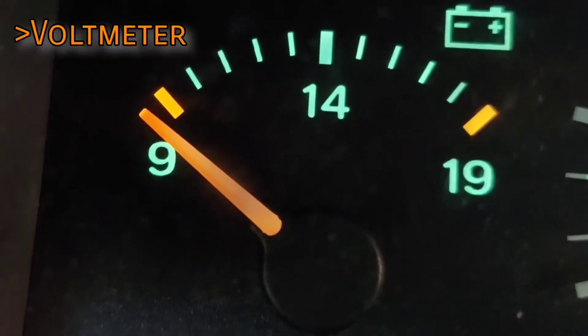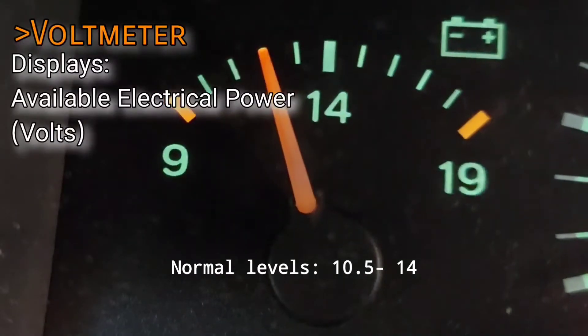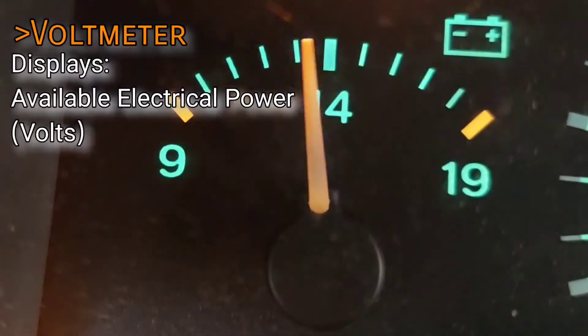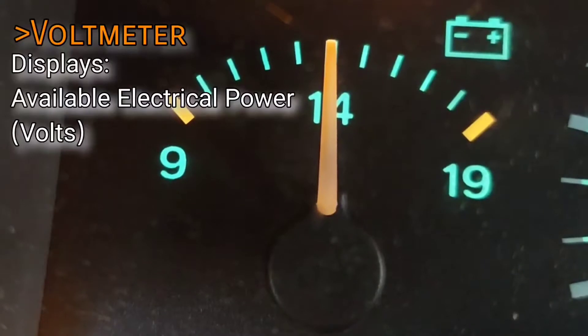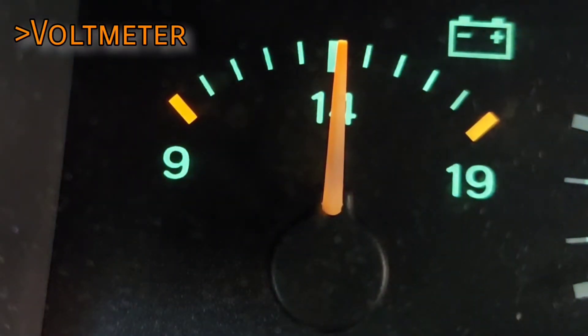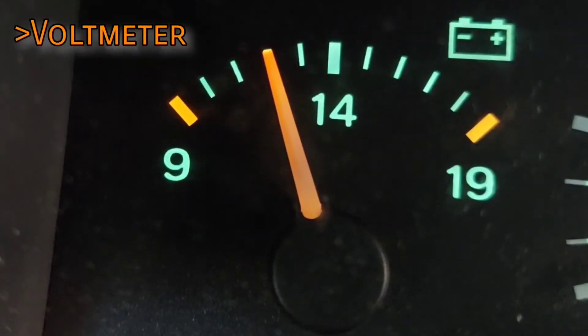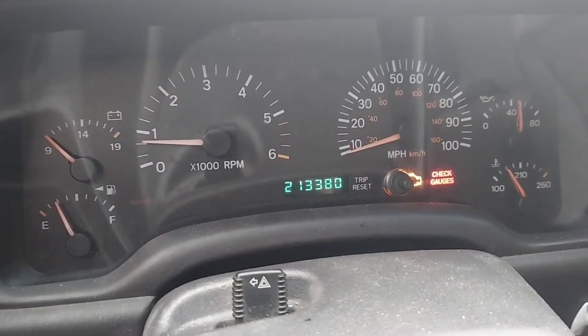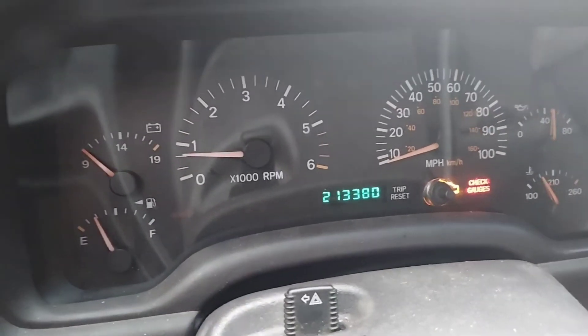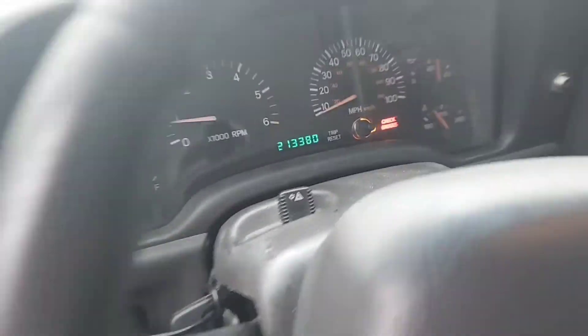The upper left gauge is the voltmeter, which measures current voltage in the electrical system. When the engine is off, it should rest at around 12 volts. It shouldn't fall below 10.5 volts while cranking over, and while running it should be at 13.6 volts. If it reads lower than normal while the engine is off, it means your battery is dead or dying. If it reads lower than it should while the engine is running, your alternator is probably not charging the battery. The gauge could also be giving a false reading — it could be a bad voltage regulator, which on OBD2 equipped models is inside the ECU, so if that's bad you'll probably have a lot more noticeable problems, like the engine not running.